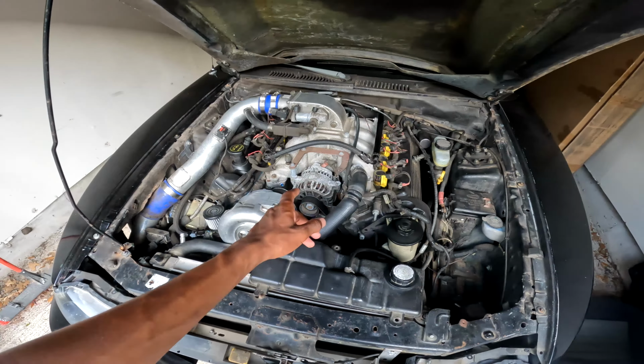Now, the issue that's preventing me from enjoying this car and actually driving it is whenever I take this car over 2,000 RPM, barely giving it any gas, the car will stutter and die. The fuel pump sounds like it's turning off and on, which I diagnosed back to a failing fuel pump. Since it doesn't even prime properly anymore, I'm assuming it's the pump. But my luck, it's just a loose ground, and this will all be fixed up within the next couple of days. But I'm already prepared to go ahead and buy another fuel pump for this car.